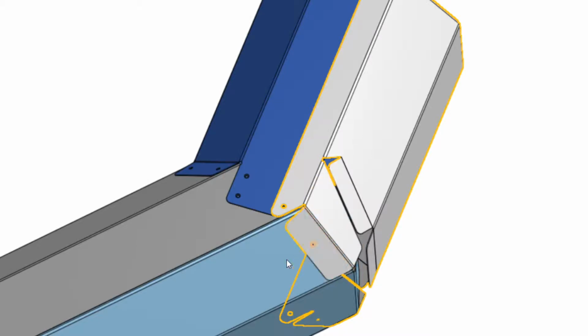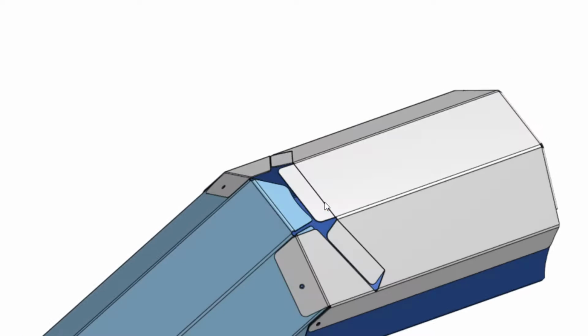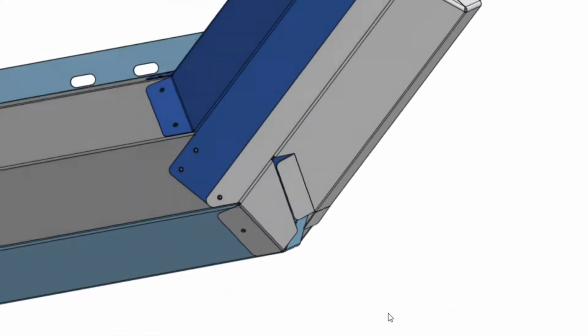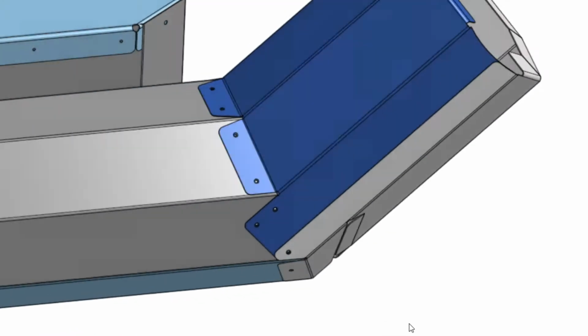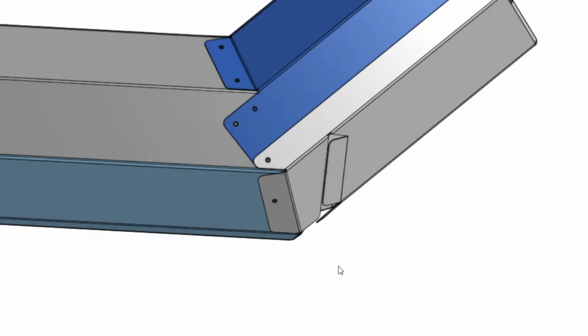This one wraps underneath here. And you may have to bend these out to the side and then kind of flip them underneath, because there is going to be this piece of steel that comes up. Let's view it from that perspective. That's going to come up here and shoot up into this space to support the exhaust pipe. It's welded to the exhaust pipe. So these flanges on the side will kind of wrap around and hopefully go behind that support piece of steel.